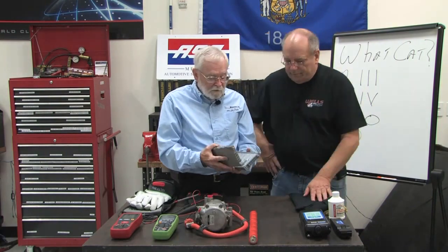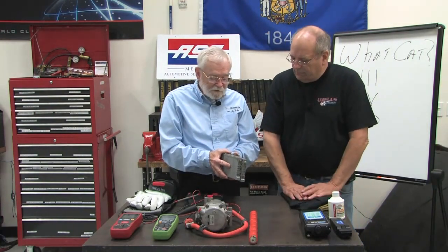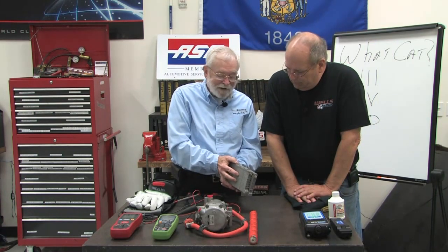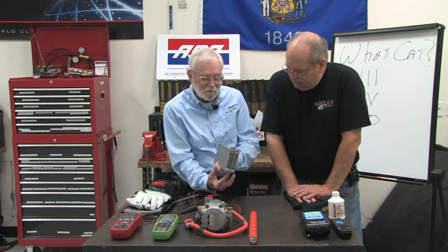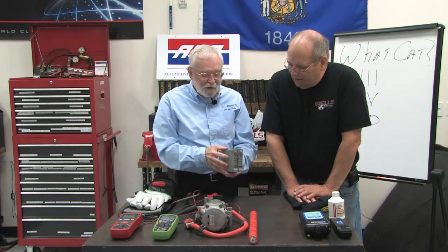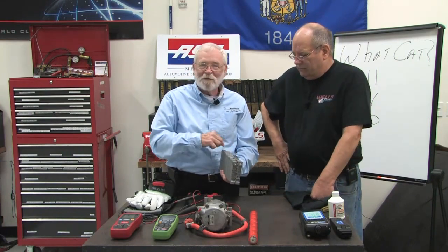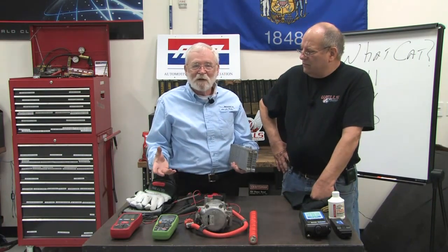The other thing you notice that perhaps when you hook these together, there's air spaces in between the two. That's how they're cooled. The air comes in from the bottom and works its way up. So if you have pets running around the vehicle with fine hair, things like that, it'll plug these up after a while and the batteries will overheat and they will fail.